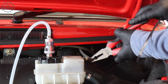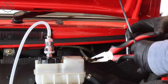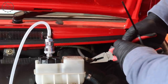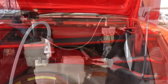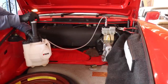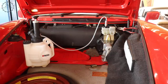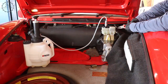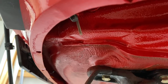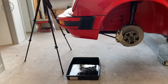Except one thing. You see, back in the 80s, brake fluid included substances that resolved paint. I remember it like yesterday when little greasy fingers used brake fluid in the family's bathroom to strip the paint off his model cars after I created runs and fingerprints. Quite uniquely, Porsche therefore provided their cars with a hose that would conduct the overflow into the open. It needs to be disconnected, otherwise it's not possible to pressurize the system from here. I'm sure there are more professional tools to do this, but the method with the tongs does the job, as long as the zip tie doesn't slide off.